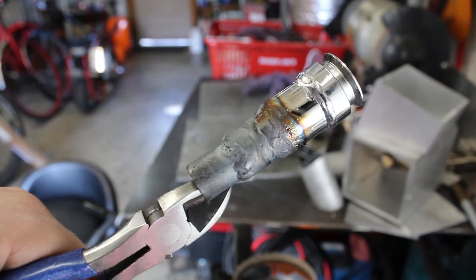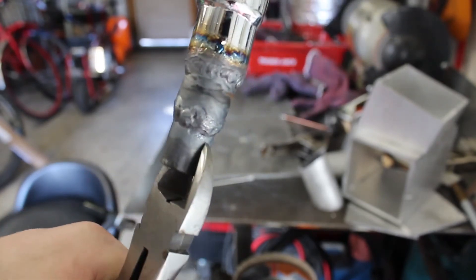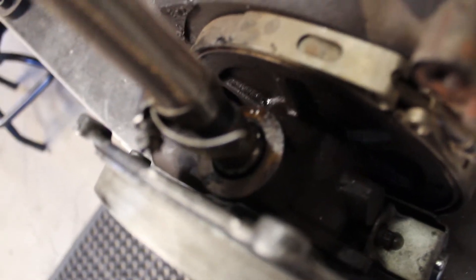Here's what we got — I took the O-ring out but that'll go in, and I'll weld this on. The hose will connect to the bottom part. My welds aren't that great because I am learning how to TIG, but they'll work. I'll basically weld it around there, weld it in, and then on the other side I'll take another piece of tubing and weld it onto the side of the oil pan — I'm going to wait until the motor is in the car for that. So as far as the turbo drain and feed goes, that's going to be it for this episode. I really appreciate you guys watching, I'll try to have another video out soon — thank you, bye.